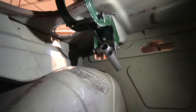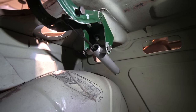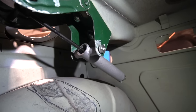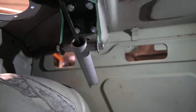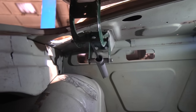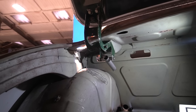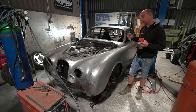Basically it's a tube with a lug on the bottom with a gas spring fitted to that onto a stainless steel shoulder bolt. The body of the gas spring goes through the centre of the tube, and on the other end near the top — where the rod goes in — on the outside of that tube there are two threaded bosses that take two more shoulder bolts and bronze bushes going through the original hinge assemblies. The rod from the gas spring then goes onto the body of the car, giving the resistance for the boot lid. The spring works neatly contained, not taking up any space we don't have in the boot.